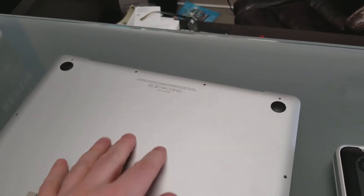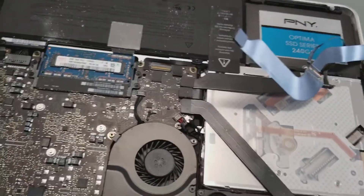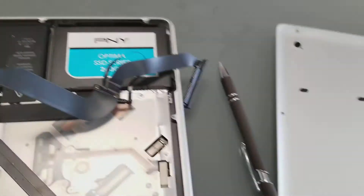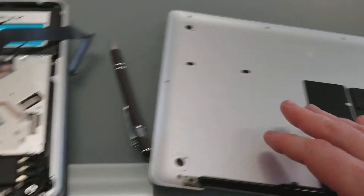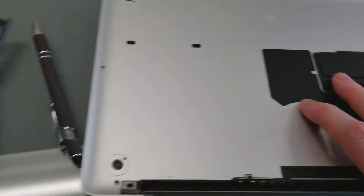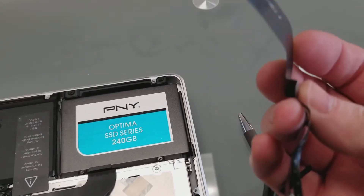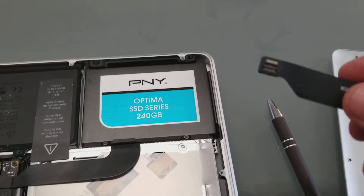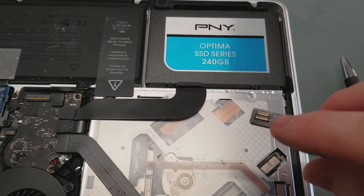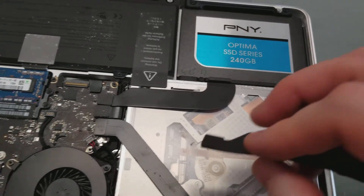I was wondering how this could happen. On the Mac, the bottom is aluminum, and if you push on it, it does flex. So if you put the laptop on your lap, this portion touches the cable and will eventually flex it long enough where internally the leads either stop conducting or break. The connector could come off too — that's all because the bottom is pushing on this part.